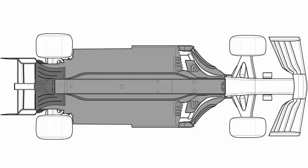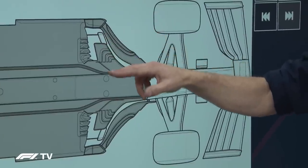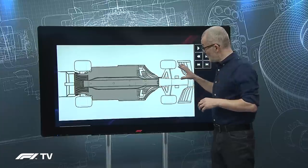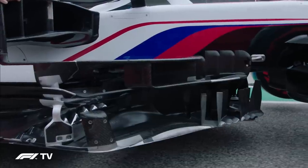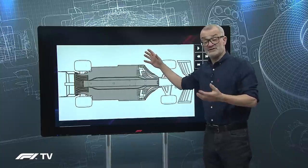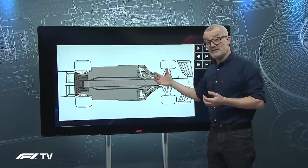Looking underneath the car, all of the fingered vanes, grooves, and slots in the foot plate of the barge board are visible, as are the teeth at the front leading edge of the floor. You can still see the outwash effect, but what you now have is all of the downwash the front of the car produces pushing airflow through all of these slots. This accelerates air under the front corner section of the floor and out of that area — creating significant downforce in this front corner section of the floor. This is what makes barge boards such a powerful device nowadays.